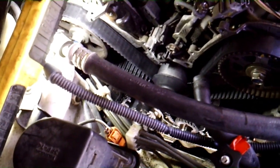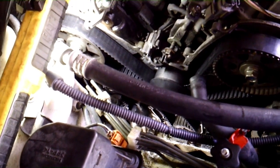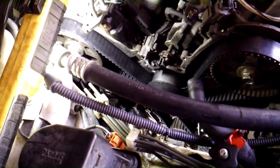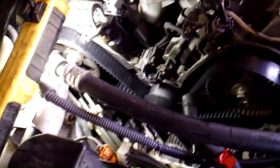On this video we're going to do the oil filter adapter housing. It's pretty easy. There's a rubber seal behind it and it leaks — it gets hard and kind of contracts and then lets oil go past. There are two electrical connectors on it and three bolts. I'll get you under there and we'll start taking these off and show you how to clean it up.